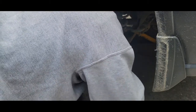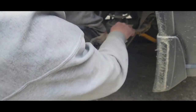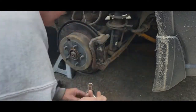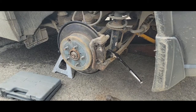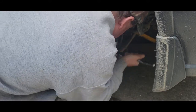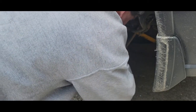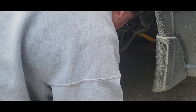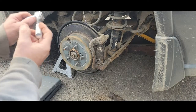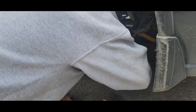Just two years and the bolt has about worn out. We get a major amount of salt on our roads. I'm going to grab a six-point socket instead of the 12-point. Got a six-point impact socket on a half-inch swivel ratchet — got that bolt loose, though it was tough and kind of rounded over. Going back to the smaller 12-point. This rust is terrible.